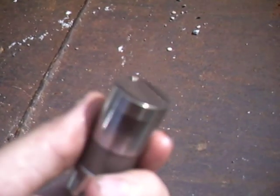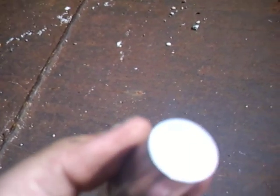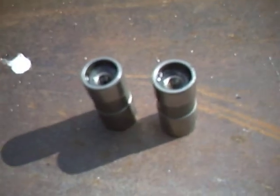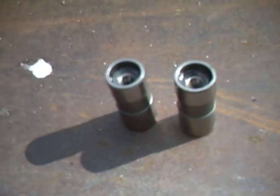It's like sandpaper and it'll shred apart that new cam. So you always want to put new lifters in — unless you're just fixing it to sell the car, then who cares, it's their fault for buying a crappy car. But that's the difference between a bad lifter and a good lifter, and how to notice it on any engine. Alright, comment, rate, subscribe. Talk to you guys later.